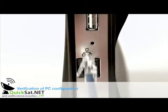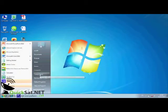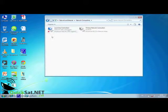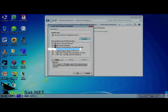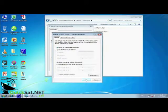After modem boot up has finished, plug in the ethernet cable, then connect your PC to the modem. For Windows 7, click on Start, then Control Panel, then View Network Status, then Change Adapter Settings. Right-click on Local Area Connection and click Properties. Click on IPv6 to deselect it. Click on IPv4, then Properties. Check that Obtain IP Address Automatically is highlighted, then click OK and Close.